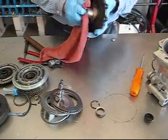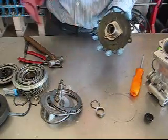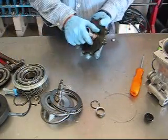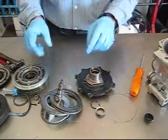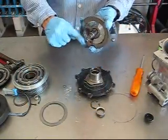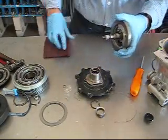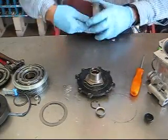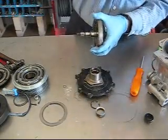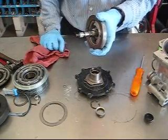Being as clean as you can, wipe everything out — try not to get lint, and look for any corrosion in there. Next, take your shaft assembly and you will notice there may be some scarring or wear from the seal itself. You can take a little Scotch-Brite pad or some fine emery cloth and wipe it a little bit. You want a clean, perfectly smooth surface to keep that seal.